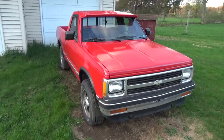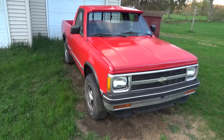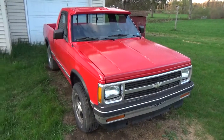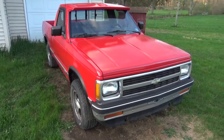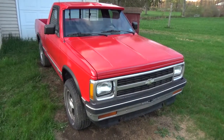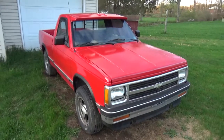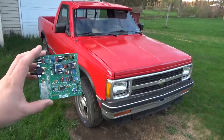The main reason I'm making this video: it's a 5.3 LS, most likely going turbo — probably a 76/65 or something quick-spooling because it's a manual and I'm keeping it that way. And the engine management: Speeduino.